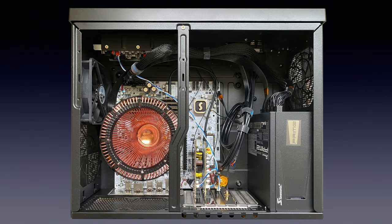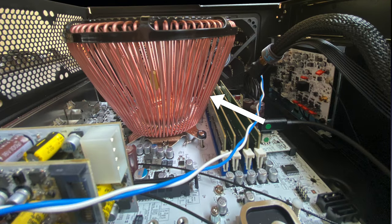When the lid of the case is removed, we first see the enormous cooler on the left side with below it the motherboard. The master clock board is mounted here while the USB card is in this slot, with next to it the Ethernet card. Let's dive into the case to look at the cooler from another angle — you now understand why the case had to be this tall. It has countless copper tubes to get as much cooling surface as possible, so that the fan only has to work at very low RPMs to be virtually inaudible. On the right side we see the master clock board, connected over blue and white cables to the DC input on the rear. The four clock signals are connected from here over black cables to the USB card, the Ethernet card and two places on the motherboard. This connector goes to the BNC on the rear of the PC.